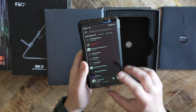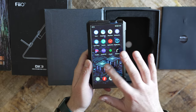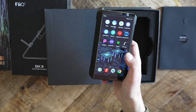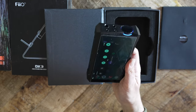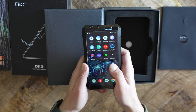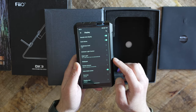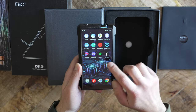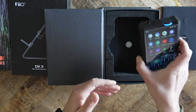The screen is a large 1080 by 2160, 18 by 9 aspect ratio screen, approximately 6 inches. FiiO does not clearly state this, but this screen is an in-cell LCD. FiiO also does not indicate which type of in-cell screen this is — AM+, BQ7, BQ7 hard, or BQ7 soft — all of which come at different price points, brightnesses, and scratch or break resistance.